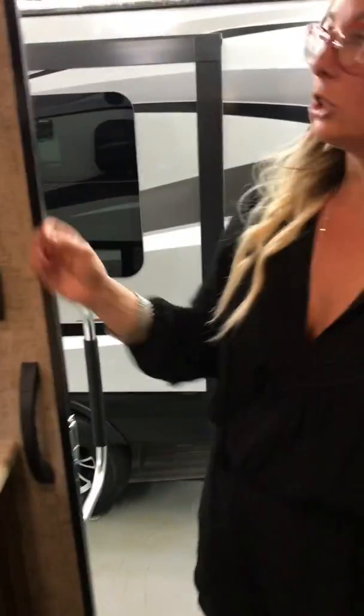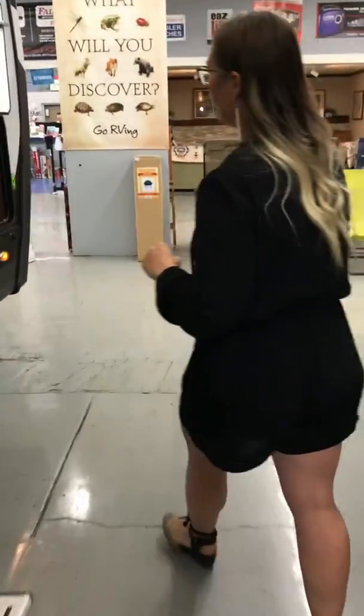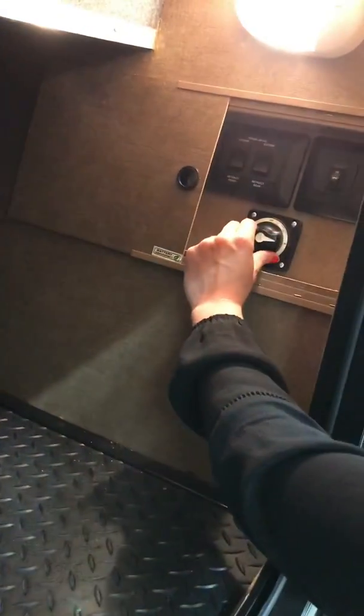So it's storage time. You turn the solar panel to on. Then you're going to come out to the compartment — most of them should be in the same location. Some of them are red, some are black; it kind of depends on the year you have. And you're going to switch this from on to off. Once you do that, that's going to kill the power to the coach. And then that way, that little 10 watt panel is just trickle charging those batteries for maintenance.